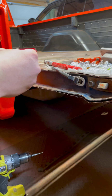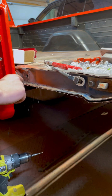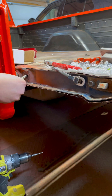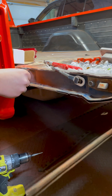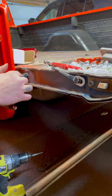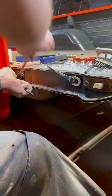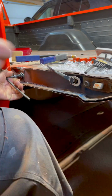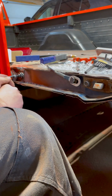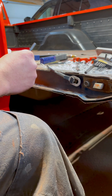So this nutsert actually comes with the kit. All you do is drill your hole big enough, put the nutsert in here, hold this nut while turning this with an Allen key. Just till it's snug, don't overdo it. And then back it out.